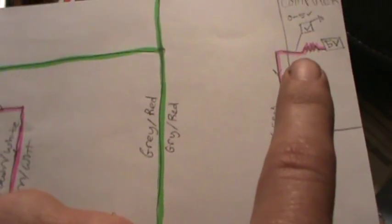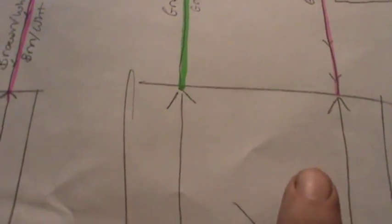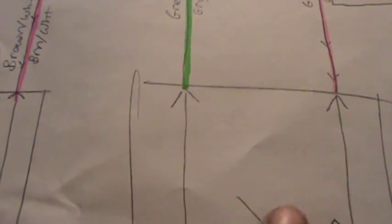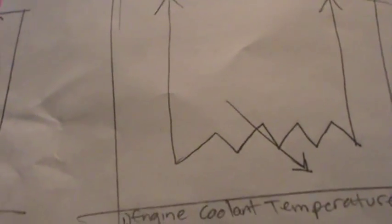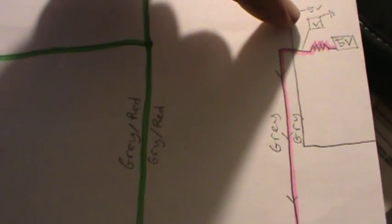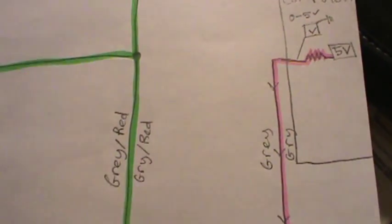If you unplug this connector, you're going to read five volts. If you have this hooked up to a scanner, it'll show five volts. Once you plug it in, it's going to go to about 4.5 volts because you're dropping some of the voltage through this resistor right here. When the temperature increases, the voltage is going to decrease. If it's an engine coolant temperature sensor, when the water gets hotter, the voltage is going to drop. The computer's going to see that the voltage is dropping because it's taking a measurement right here. So it's going to read anywhere between zero and five volts. Zero volts is going to be a hotter temperature. You're never going to be exactly zero and you never want to see exactly five.